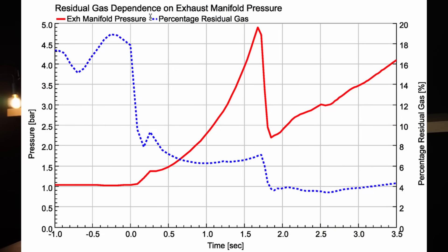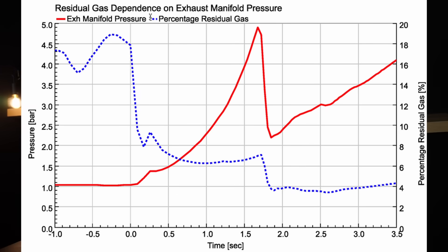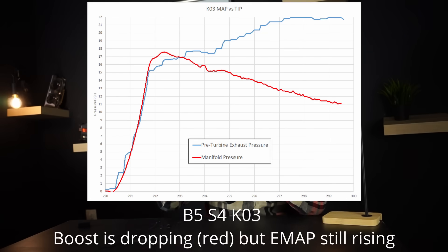The thing we are talking about is exhaust back pressure, or rather manifold pressure — not in the intake manifold but in the exhaust manifold, between the exhaust valve and the turbo, where there is a lot of pressure. In most cases there is more pressure there than on the fresh intake side. When that pressure difference becomes too high, the exhaust manifold pressure pushes old exhaust gases back into the combustion chamber where they mix with fresh air, causing the engine to make less power.